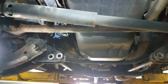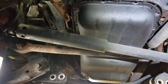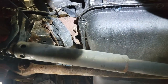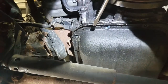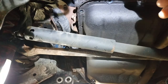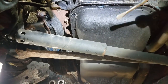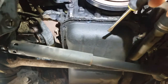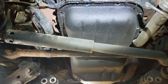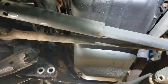Once you do that, how do you pop the oil pan out? Some mechanics put a screwdriver in here and pry it down as hard as they can, which I don't agree with. The front timing chain cover is made of aluminum — if you scratch that, you can put silicone and it will seal, but don't take the risk. Just have patience and do it slowly.